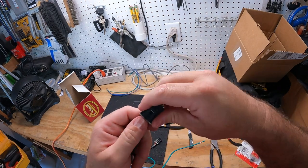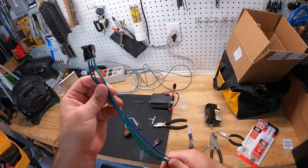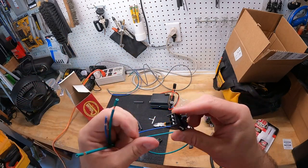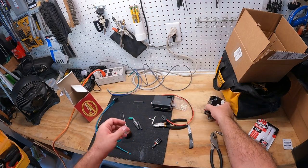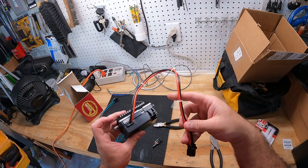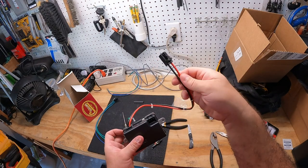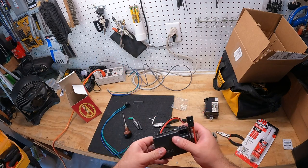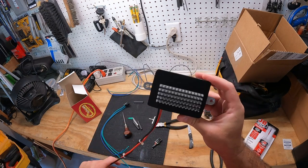That should have the new harness built from this end, ready to go back into the car. I may leave the wires a little longer to make it easier to plug stuff in. I still need to go in and cut the wire that was hardwired — splice those together and make a hard connection. I'm not sure if I can reach the connector up underneath the dash; if I can, I'll pull it out and plug this one in, otherwise I'll splice these two together. Then we should be able to plug this module in and hopefully turn the car on and get some AC.